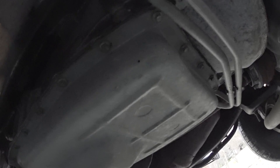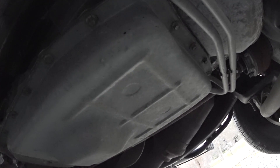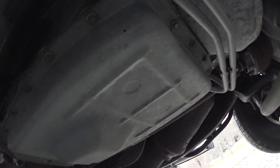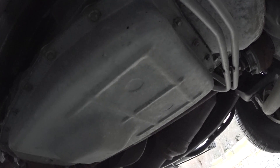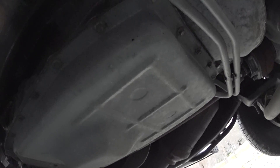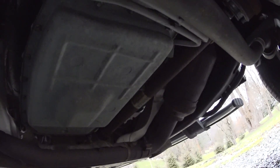The filter is good. Those type of filters are not restrictive — they're not like an engine oil filter because there is no pressure, it's all suction. So it only filters big chunks of metal or big particles, nothing small. Ford says don't change them unless you're really abusing your vehicle, like towing constantly. Otherwise there is no need to replace it.